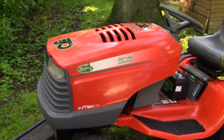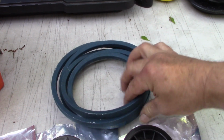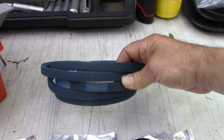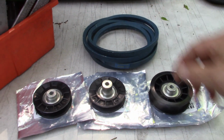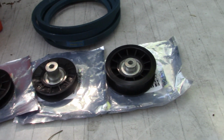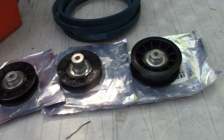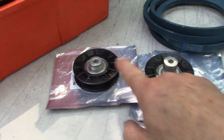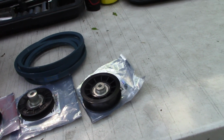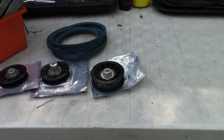So let me show you what you need in terms of parts. I've got them over here on the workbench. And of course, mainly we need this drive belt. This is a 1/2 by 96 inch, 1/2 inch by 96 inches drive belt. And while we're at it, I want to replace these idler pulleys that are all part of that drive belt system. And there's 3 different ones. This flat idler, then these 2 grooved idlers. One has a short stem, one has a longer stem. I'll try to leave the part numbers in the description where you can get those items.